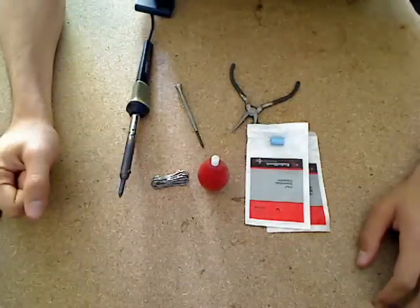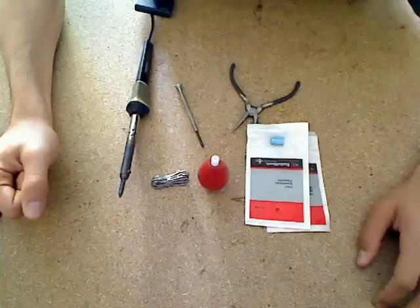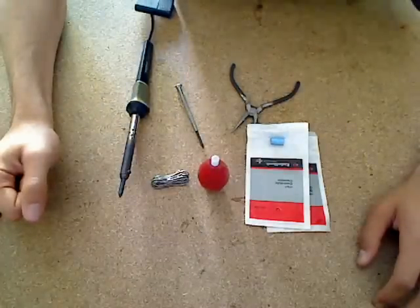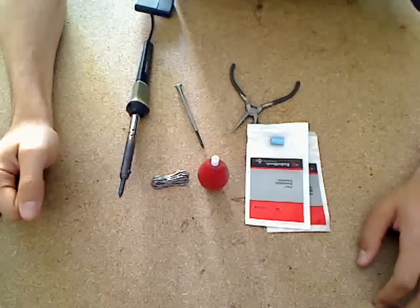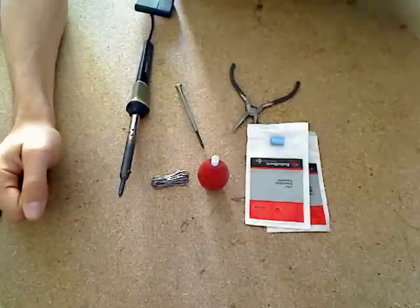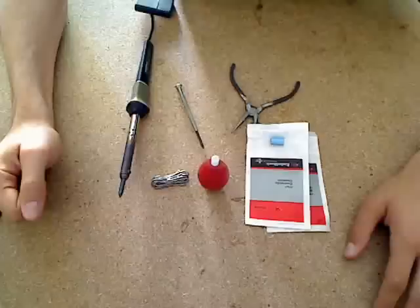In this video I'm going to show you how to replace the C13 and C14 capacitors on your PanSat 3500 receiver. Before you get started, you should check the receiver to make sure the settings are correct, all cables are connected, the dish is set up properly, and there's nothing blocking the dish. But if you've gone ahead and checked all those and you're still having problems, then you need to check the power supply to see if these capacitors have been burnt out.